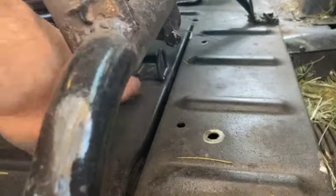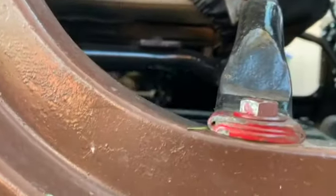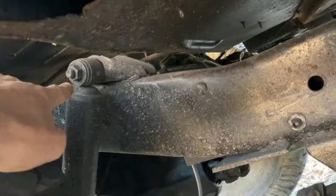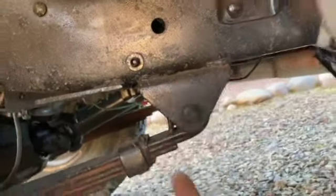You've got to take this off, you've got to work inside here, there's no room. This one has rotted out all to heck. I've patched it. I did a huge patch here. I left this little chamber open for water and crap to get out, and this is a quarter-inch plate I patched with. Now, you do need bracing. This open channel, you want bracing right where the perch is and the other perch, and you need bracing there. As you can see, this one already broke.